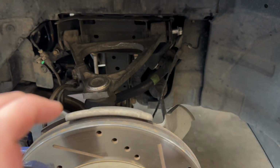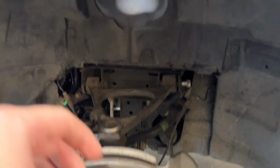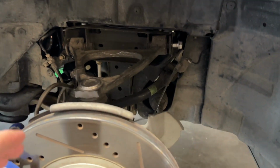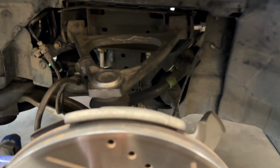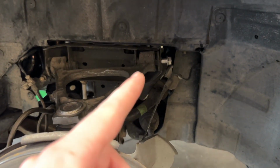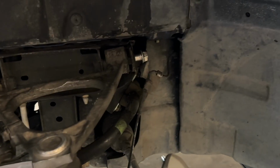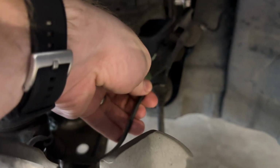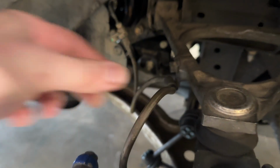to tilt out as you pull the coilover out very carefully, not to damage your fender. Found that works really well both times I've done this. And then when you're not doing anything, just put one of your A-arm bolts back in place just to hold that upright, because you don't want to put too much tension on your ABS sensor or your brake lines here.